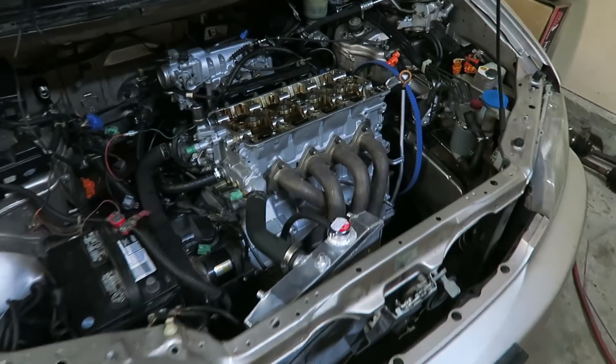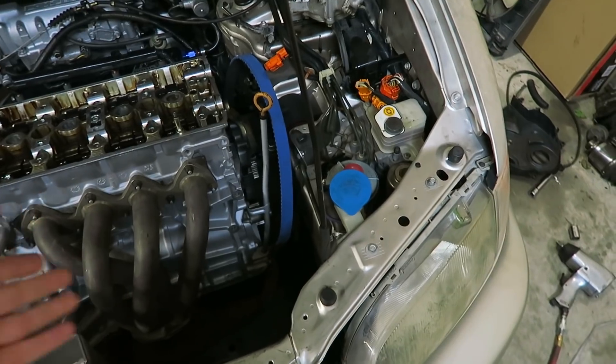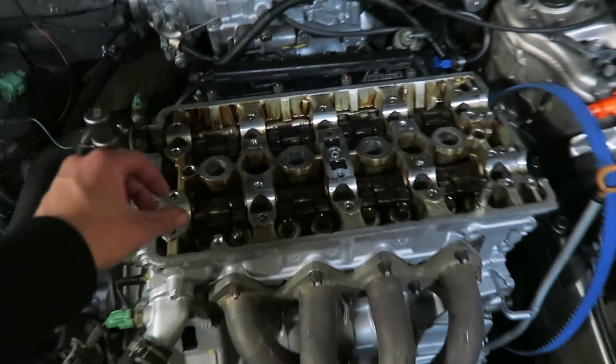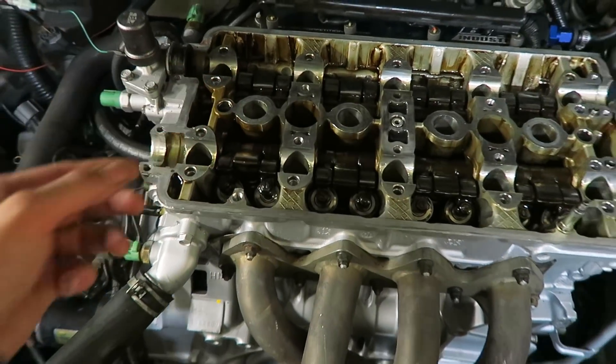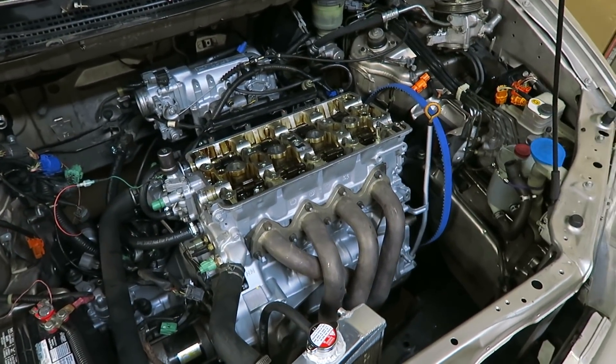It's smoking a little bit on the side. We went ahead and got the camshafts out, the timing belt off, and all that stuff out of the way so we could inspect the rocker arms and check if the VTEC pins are all in place.